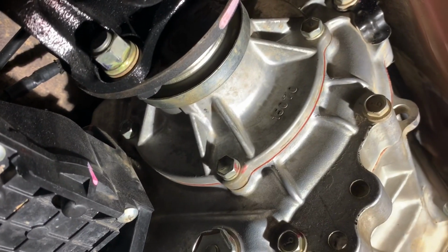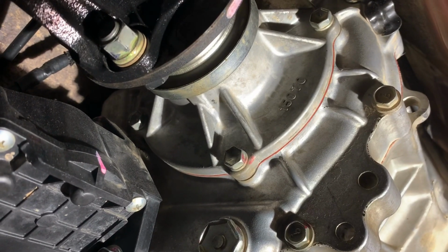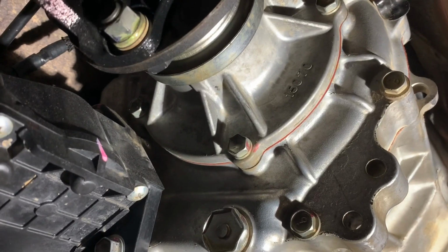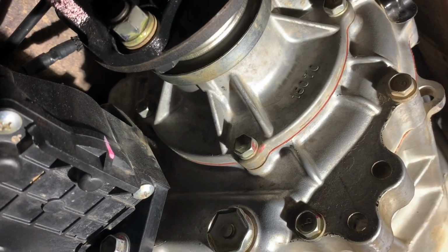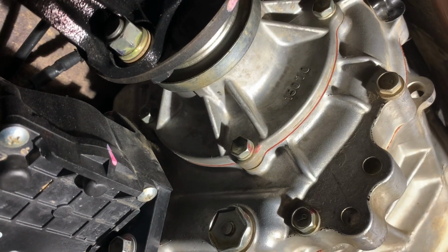You just take off the transfer gate bolts. Obviously, you're not going to have to deal with leaks because you're only taking 1 bolt out at a time and putting it right back in. So take those out, move them around. The e-brake, you got to take the console off to get to it, it's the far back right one. That's the one you got to take out and cut a 1/2 inch of it off. So pretty easy.